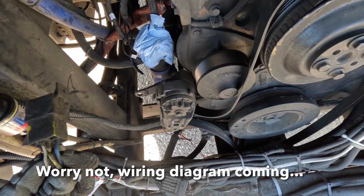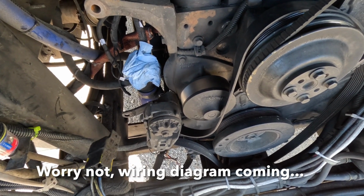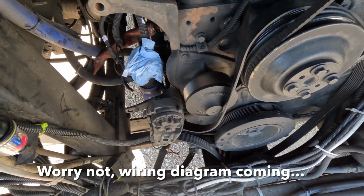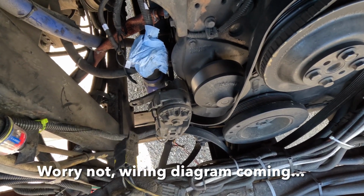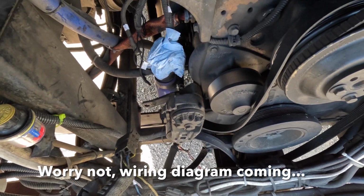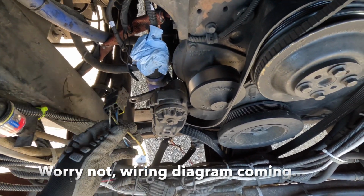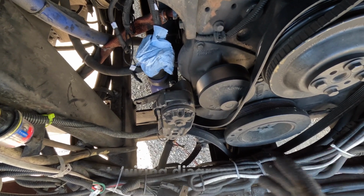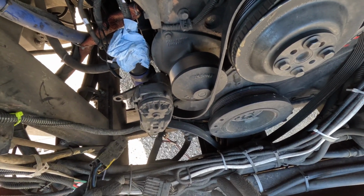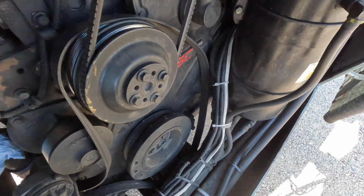But my coach doesn't have a DUVAC system, so basically this number 2 is actually a voltage sense. It's like a bypass for the voltage because it directly feeds the positive terminal on the alternator itself to this battery sense, which is not how you're supposed to use a battery sense, but it has this thing just for the alternator. But then my new alternator doesn't have a battery sense, nor does it have an ignition, nor does it have a DUVAC. So I don't need this altogether. I can just throw this away.